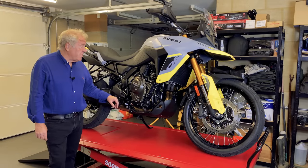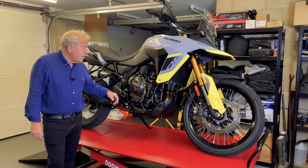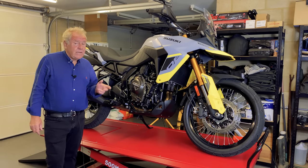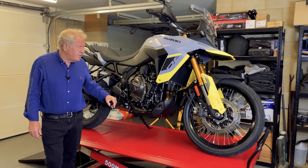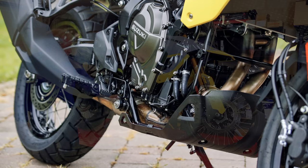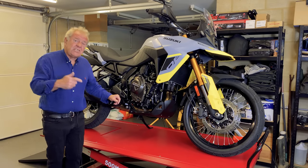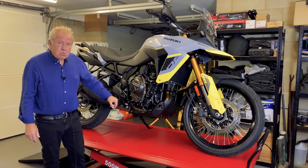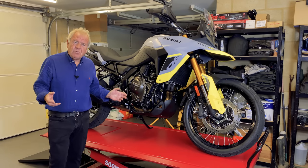Let's, as I often do, start with the engine. It's the new Suzuki parallel twin. It's liquid cooled, it's got 8 valves, and it produces 83 brake horsepower. That's slightly more than the road going version of this, but I'm guessing that's down to the tune of the bike. Perhaps more impressively, it produces 78 newton meters of torque, which compared to the 650 that it's in the process of replacing, that's a 25% increase, and that's something which I'll come back to when I talk about riding